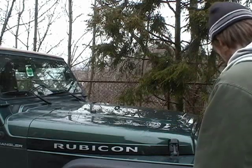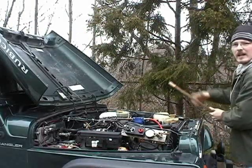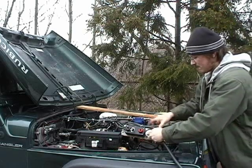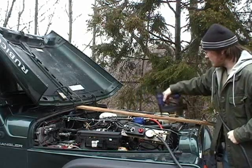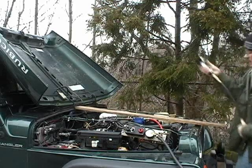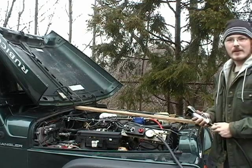With an on-board air system, we do. I'll be explaining how to install, in my case, a Mopar RV2 AC compressor re-appropriated as an air system. This will allow you, when you're finished, to power an air nailer if you need to, and then use an air cutter if you need to cut those nails off.